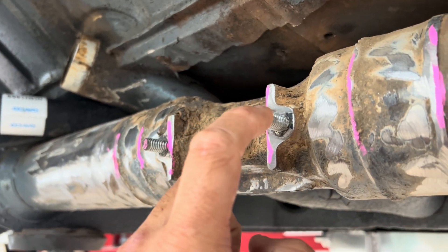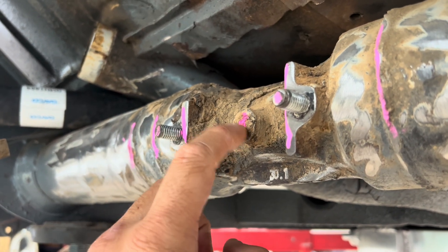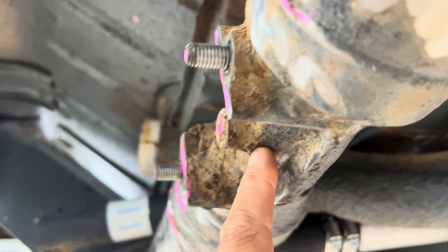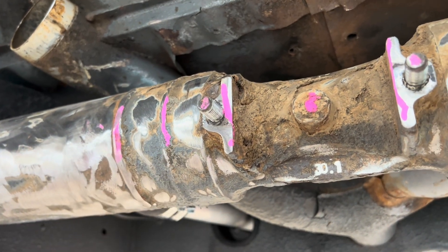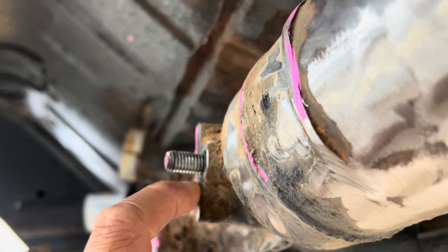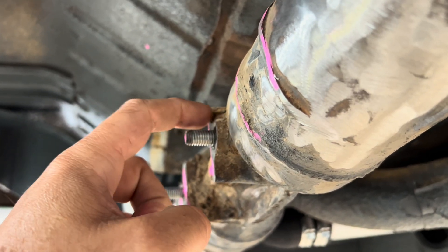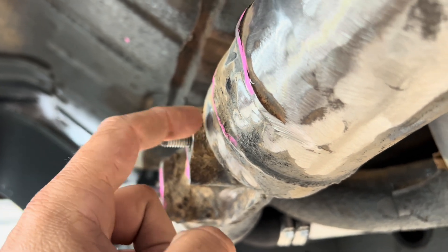The studs need to either be taken out or cut off with an angle grinder, both studs. And then this little knob part needs to be ground flat back to here, which we'll take photos of when we've done it. And also these here need to be flush. This part here needs to be back flush to the torsion housing tube as well. That whole flat part needs to come back ground flat flush with this.